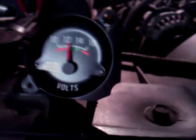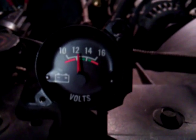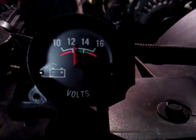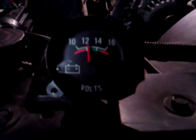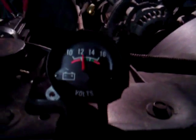They all go back here to the battery — that's where I've hooked them in, those jumper cables right there. So it all goes to this voltmeter, which you'll notice is right on about 12.3 for right now. So I'm going to start up the truck. You'll notice it's on 12.3. We'll see if this gauge is working, because in the bus I know the alternator is putting out 14 volts, but for some reason all the other things in the bus are only getting like 12.7. So this is just a test, just for the fun of it. I just want to test this gauge. Now this truck — I know when it starts up, this truck's battery is kind of bad, it's kind of wore out, I need a new one — so it's probably going to shoot up here and I'm interested to see what it does. I had to put a little power steering fluid in it because I've got a little bit of a leak. So let's crank this up, just for the hell of it, just see what happens. This is for you, John.